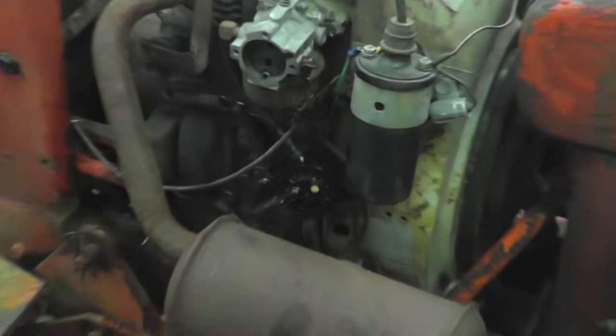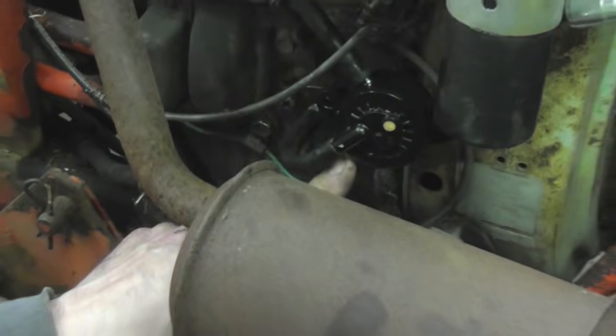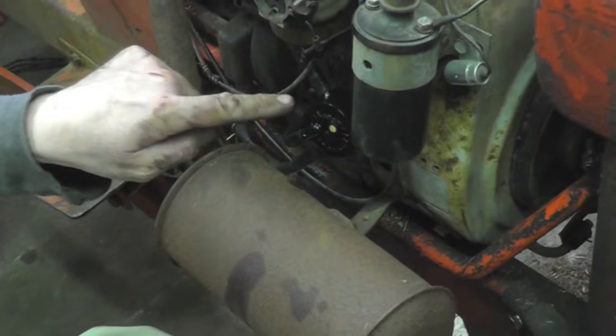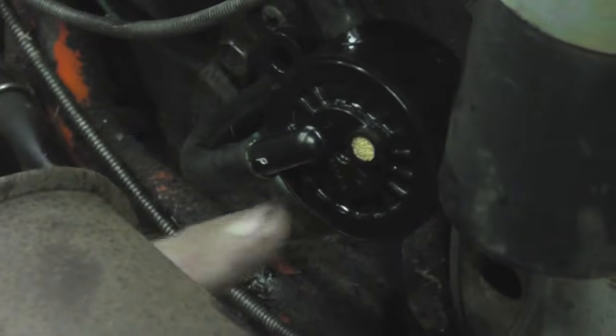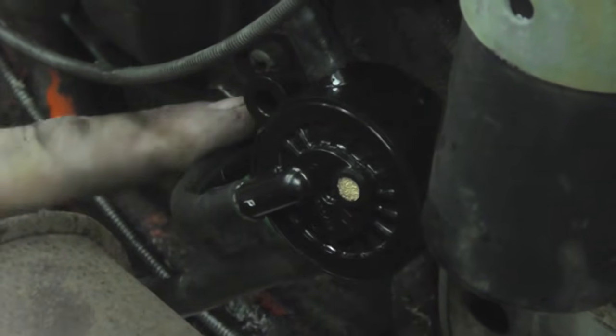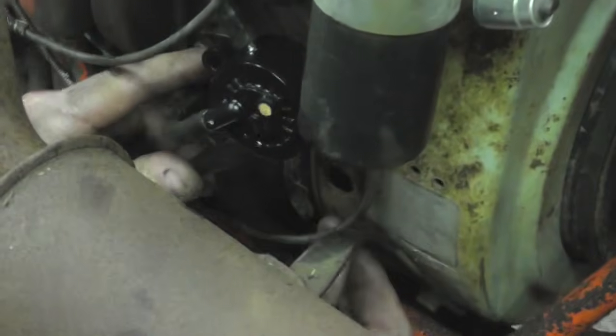Okay, now, I ran a fuel line from the tank going into the inside that we marked. That's on the fuel pump. Now you gotta look real close, because remember I highlighted them points on there. But they're molded into that. You just gotta look real close. So there's in. There's your pulse line. That's the vacuum. That's gonna come off the motor, the crankcase pressure. We're gonna make this pump. And that's the line going out. Now, I just zip tied it to this cable.